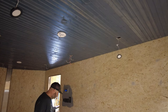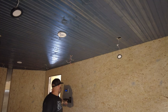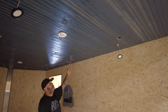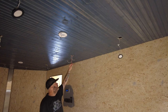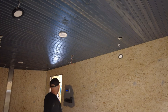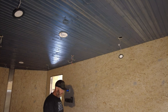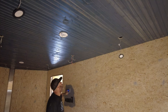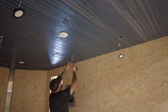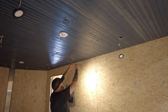This is kind of my main junction, if you will. This is the feed from one of these switches. And then these run off to lights in different directions. I did orange and purple here, and red and yellow for the other switch, different colors, so I know. What I didn't designate is which was positive and which is negative. So it's as easy as plugging the trailer in. You can see here I got power to these. This is the beauty of 12 volt. It doesn't matter. There we go. Looks like purple's white.